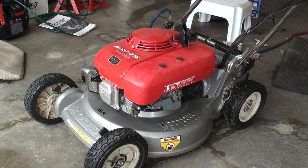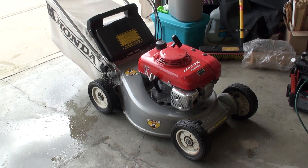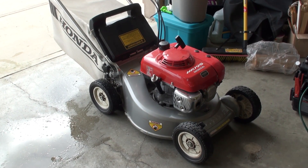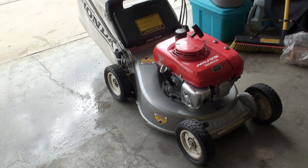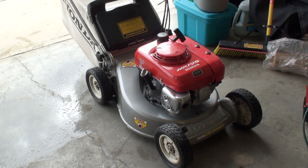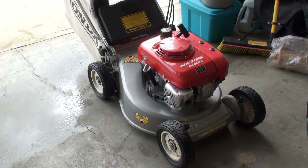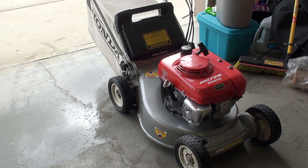As you can tell, the moment I engage the blade clutch the mower RPMs down and you can feel the blade engaging immediately. Whereas before you could hear the motor not getting loaded up right away and it would take a little while for the blade to reach full speed — you just knew something was slipping. As you can see from this video demonstration, repairing the rotostop clutch assembly on a Honda Master Series mower is very straightforward and can be done with basic hand tools. What was originally thought to be a bad clutch turned out to be glazing on both the drive and driven clutch surfaces, easily resolved with sandpaper. I hope you found this video useful and informative — rate, comment, and subscribe.